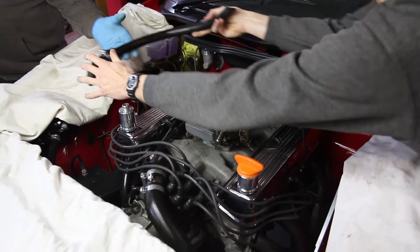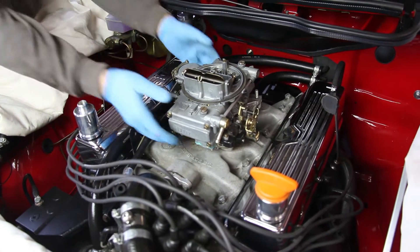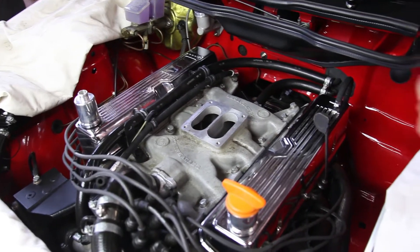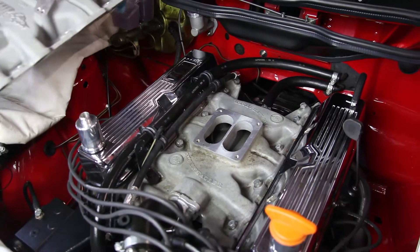We also do our power plenum which increases the engine's ability to scavenge from the crankcase. Now we can remove the carburetor. We're doing away with this carburetor because we can get far better road tune on the Weber carb. This is the Offenhauser 360 intake, which we don't use because effectively it's a drag racing intake manifold — it's open port.